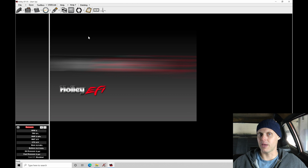That was assigning the pin location to the radiator fan control. So last video we were setting up the basic inputs and outputs. One of the outputs was the radiator fan, and I wasn't sure which output pin that has to be associated to, which in this case was B12. Let's go and assign that right now on this map before we forget, so that the fan actually works and runs when we programmed it to.